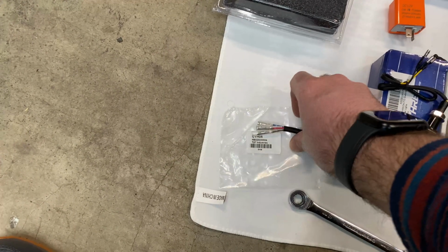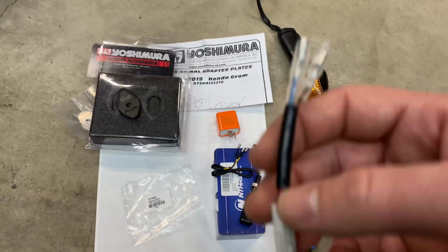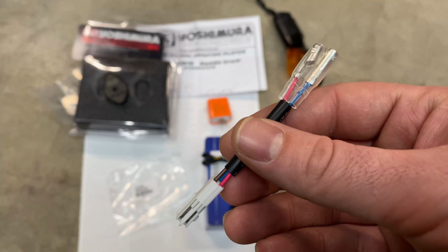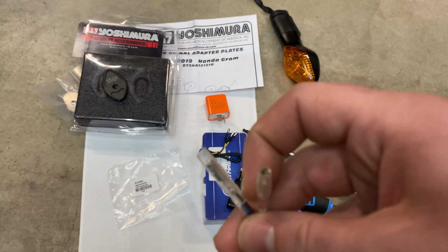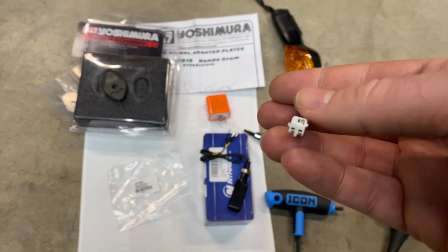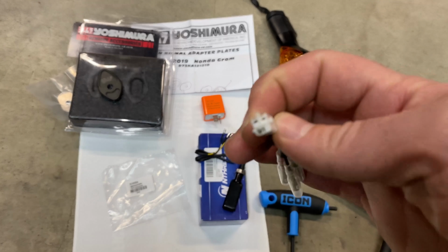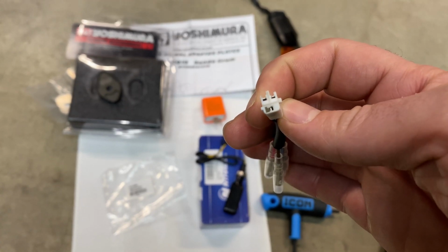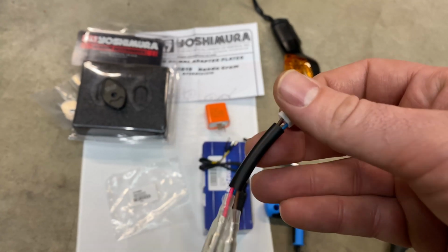This is from TST Industries. It's their Honda 3-to-3 adapter. Since the front turn signals have running lights, we need the 3-to-3 instead of the 3-to-2. If you don't buy lights with running lights, you can get the 3-to-2, and that'll be fine. I tried to find this plastic adapter to make my own, but was unable to, and I think this was 14 bucks online plus some shipping,